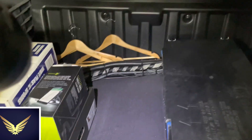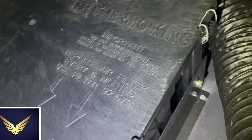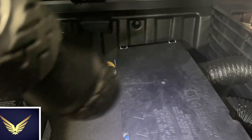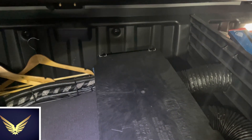You need to give it some space. It says here to replace the air filter every six months - the filter number is 92-5701. It's recommended to give at least three inches of space between the APU unit and your stuff. You don't want to have everything stacked down there. Right now my APU is not working properly and we need to troubleshoot it.